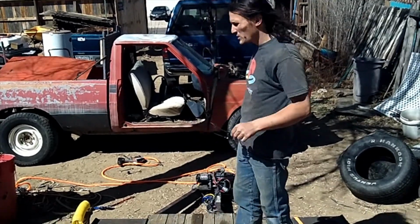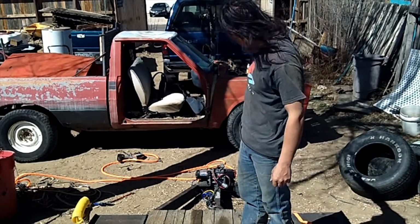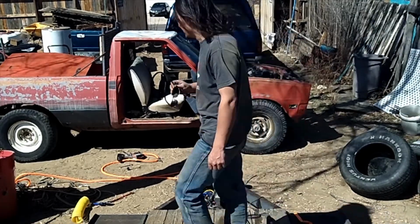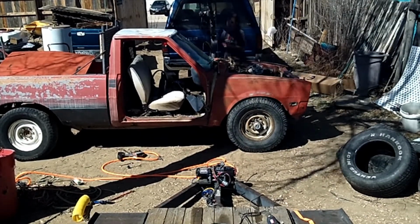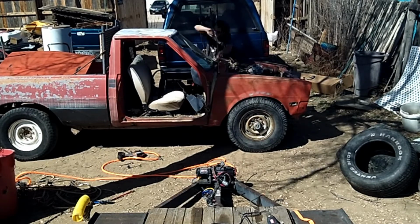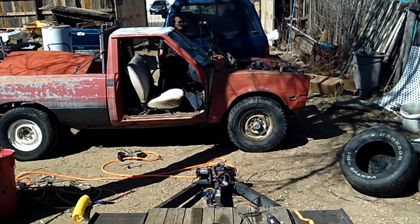Okay, well, cab bolts cut. I got some here. Use the crutch, which is what we call the little crane that sticks out of the trailer hitch. So we use the crutch to lift this cab up. Hopefully get it just high enough to squeeze this out from underneath here. But we'll see how this goes. I undid the bolts for the torsion bars, so it should be a lot lower. So we'll see how it goes. Get back up. That's not good. That did not work the way it was supposed to.